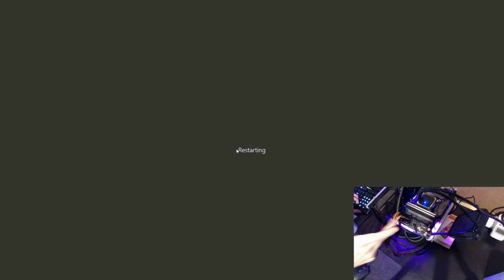And now, because I used safe boot to go into the operating system, it should boot us in at the 4000, 12, 12, 12, 28 settings. Man, this video is long. I knew it was going to be long because memory overclocking is slow and painful, but I really hope there's no errors in it.